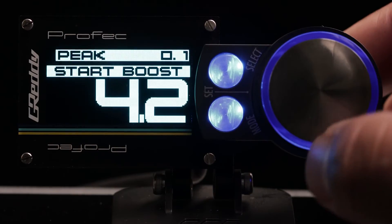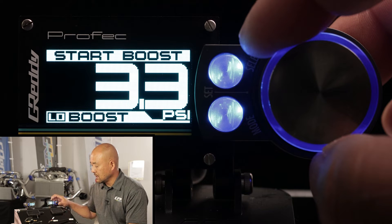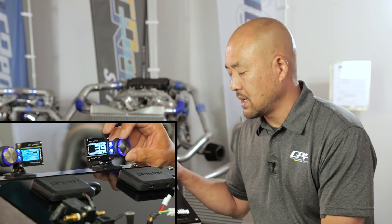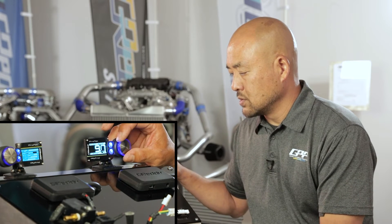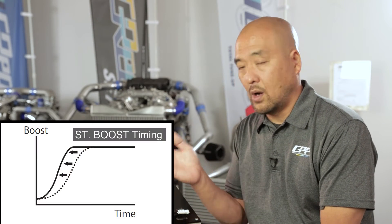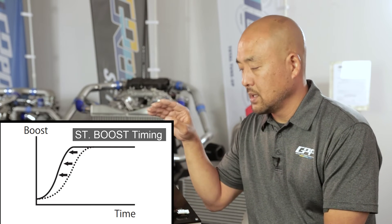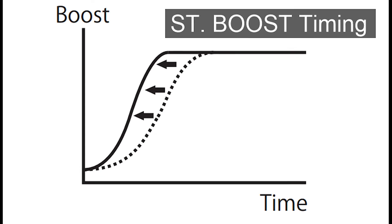By hitting set, get into that mode. The number you put in here is actually in pressure — so if you have your unit set to psi, this is the actual boost pressure setting. If you're trying to run 10 psi, you want to set it close to but not at that pressure, so around 8.5 to 9 psi. What that does is the boost controller will hold the pressure going into the actuator or wastegate until 9 psi, so you don't have boost creep. All the exhaust energy is going through the turbo until that last moment where you want the desired target boost, giving you the best response possible.